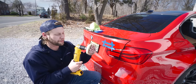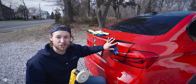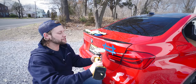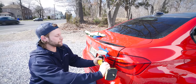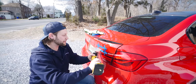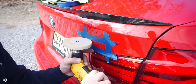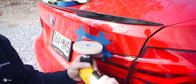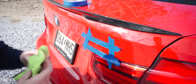Now I'm going to use the 3M eraser wheel. It's designed to be super soft and mimic that rolling motion. I just have a small outline left — I could polish it off, but I'll demonstrate for you. Mount it on a drill, go at a very slow pace, and move against the direction the wheel spins — that's how it pulls everything off. You'll see it wear down like a pencil eraser and leave some residue. Just wipe that off, then clean with isopropyl alcohol and dry it.